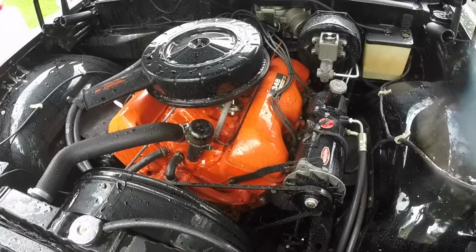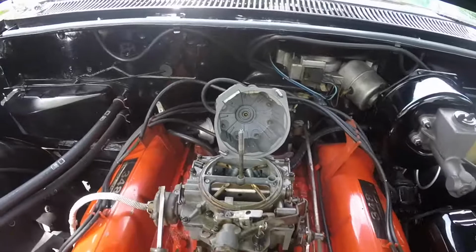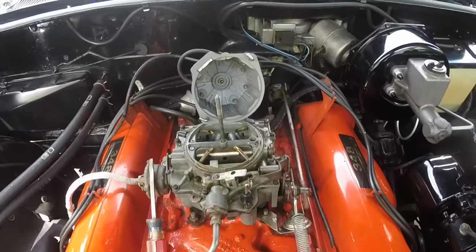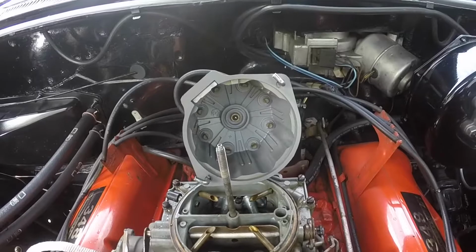After I pressure wash the engine cold, I blow it off first with the leaf blower or an air hose or something. Then I crank it up and let it come up to operating temperature for 15 minutes or so. Then I pop the cap off after it sits for 5 or 10 minutes, and blow it out